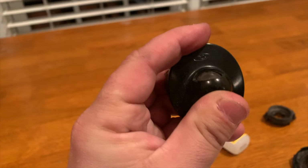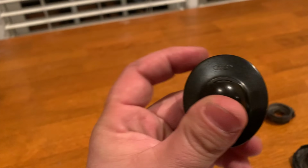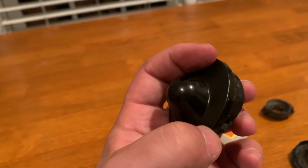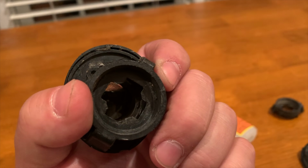So do not pull this piece off of the tailgate. Do not, I say again, do not pull this piece off of the tailgate, leave it on, come in from behind, half a click, pull out the bulb, swap it, click it back in, call it good. It's cold, it's early, I ate mornings, let's fix this problem.